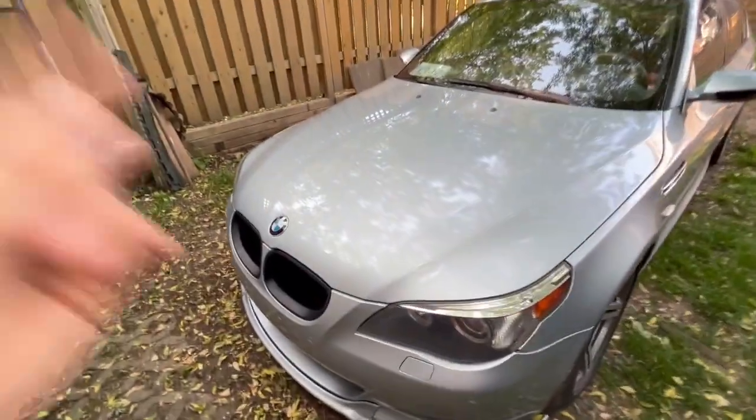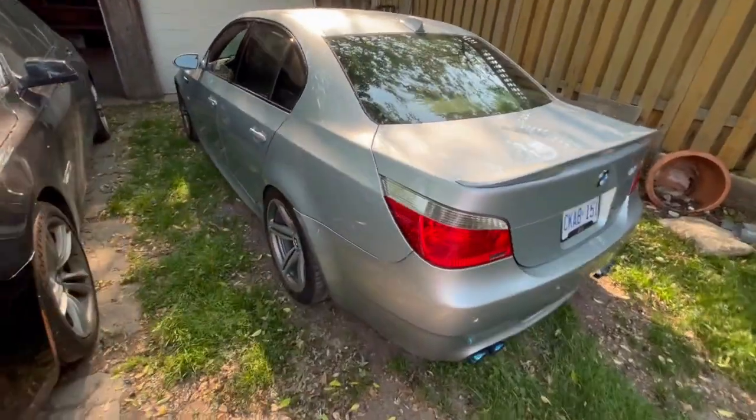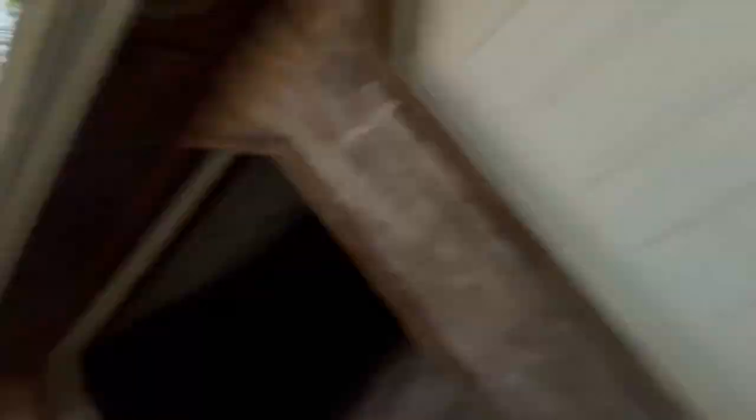That's what I wanted to talk about next — actually some maintenance I've done to the car. The top four things I think you should do to any M5: invest that extra money; if it's a car you're going to have forever it's going to treat you well if you invest in these four things. Number one is rod bearings. These are known to fail on the M5. It is worth doing, or at least checking — if you're going to buy an M5, ask the previous owner for a receipt: how recently have the rod bearings been replaced? If not, get that checked at the shop and go ahead and replace them. Spend that couple grand and do it, because if those go while you're sitting in that car, say see you later.